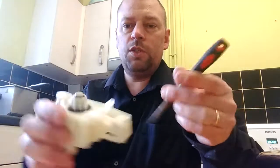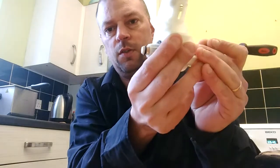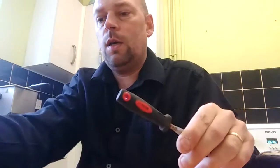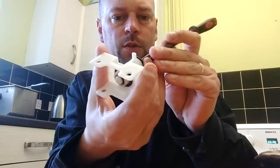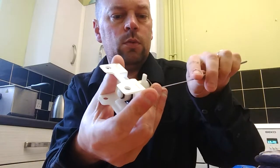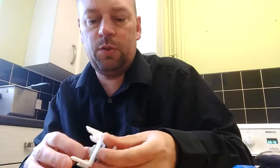The trick is, once you're cleaning this out, make sure you push the valve — the little thing on the inside — to push it out. You can see that come out there. Just wash that through as well, make sure there's no fluff in there. And also, the same with the connector that goes on the back of the tank — just push that through. It's quite tricky because this one's quite small. Fluff can collect anywhere and it can cause all sorts of problems, so when you're trying to work out where the issue is, just make sure you have a thorough clean.